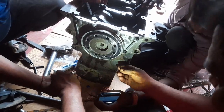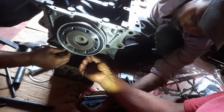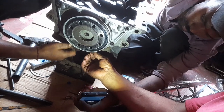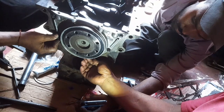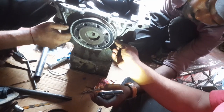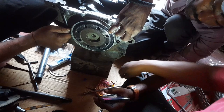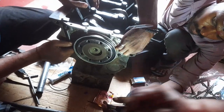This is very necessary for matching the surface of the RC plate along with the cylinder block, because if the surface is not matching, oil leakage may occur when we fit the oil chamber or oil sump on the cylinder block. After fitment, we tighten all the cap screws of the RC plate.